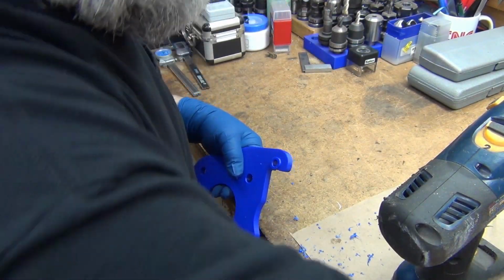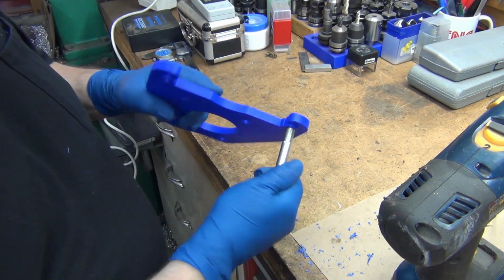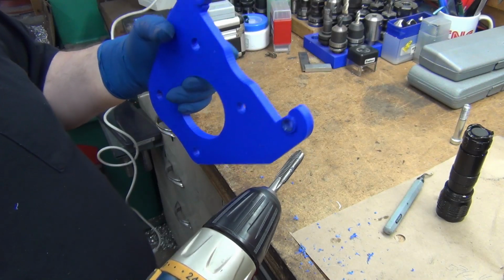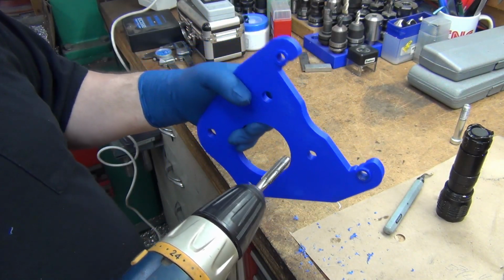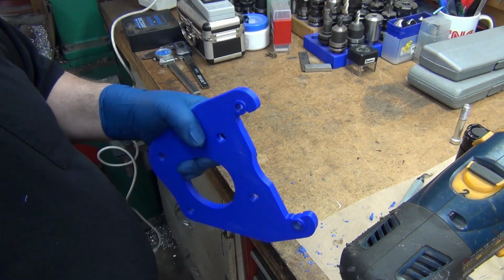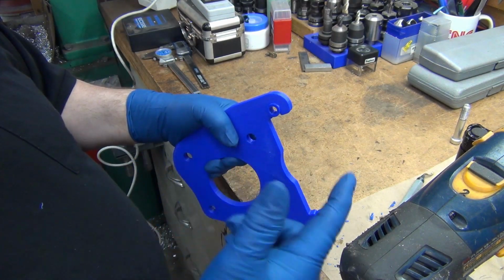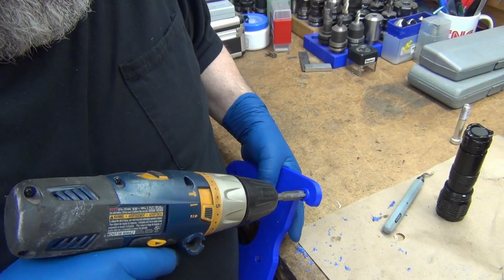The pins, I guess actually I could see whether or not... oh, look at that. Nice. The pins are an 11mm by 1.5 thread. And it just happens to turn out that I had one. So this 4-flute carbon steel tap is certainly strong enough to do the 3D printed plate. Okay, I don't know that I would trust it on a 3/8 steel plate or with these little sleeves. Now these little sleeves, part of the advantage too is I could set it up on the CNC lathe and single point thread it. And then even better, I could also just turn the OD where I want to, get the ID where I want it, and then have one of the tools be a tap and just tap it. Anyway, options.